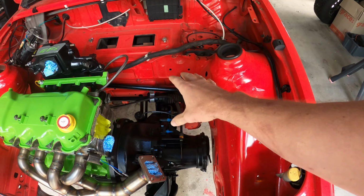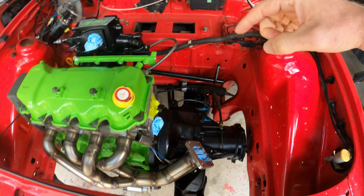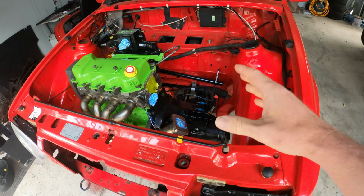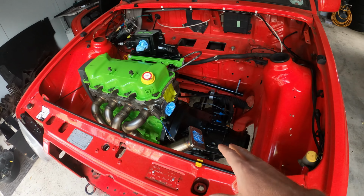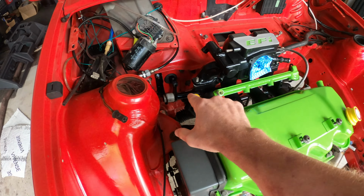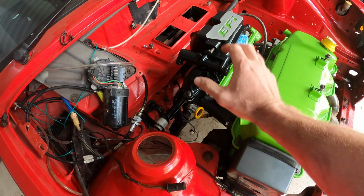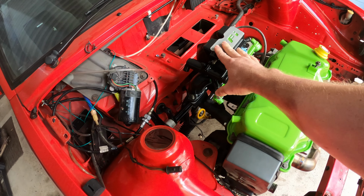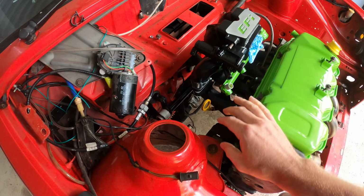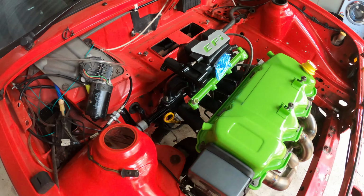Now there is a guy in the UK, I'll link his channel in the video description down below, OCD Productions. He's running the same manifold, different turbo, he's got a forged build, over 300 horsepower in a front wheel drive Series 2 Escort RS Turbo. It's an absolutely insane car, and he's running his master cylinders over here, but he's also running a custom intake manifold. Previously, he was running the Series 2 Escort MFI intake manifold with an EFI conversion down here. That gives him more space here, space that I don't have because I'm running the Fiesta EFI manifold.